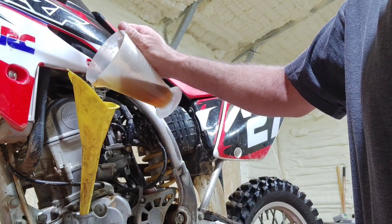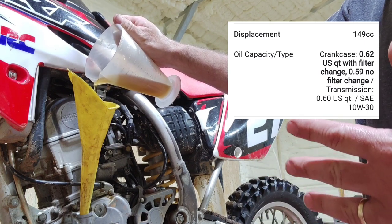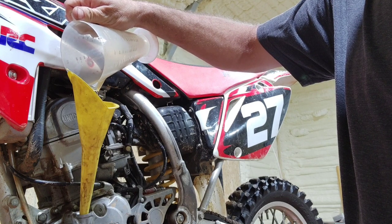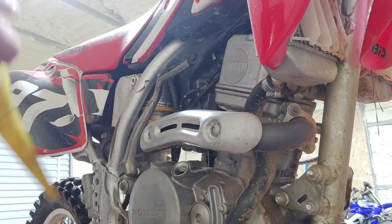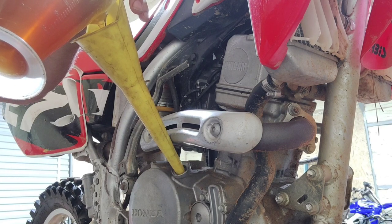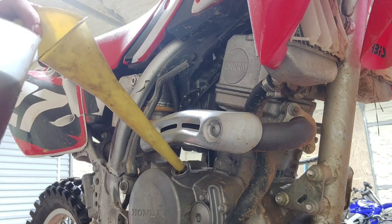For the engine side, we're doing 590cc. With this side, you can start it up afterwards after you do the transmission side. You've got oil on both sides — fire it up, warm it up, let it sit for a few minutes, and then check it with a dipstick. For right now, we're just going to put in what the manual says is 590. I'm using the GN4 10W40. Clutch side, same oil, but we're doing 580 in here. The engine side, you can do 560 if you're just doing an oil change without the filter. We go a little slower on this side because the clutch is right there.